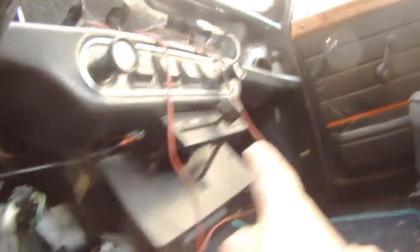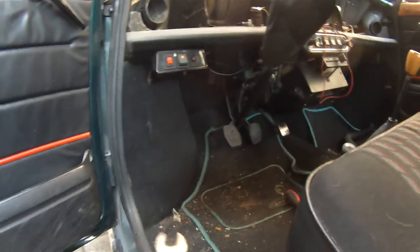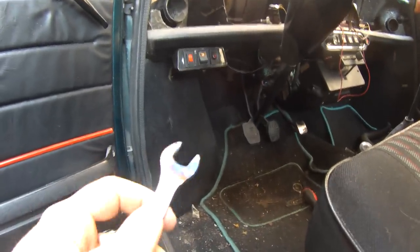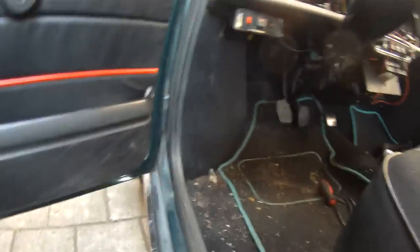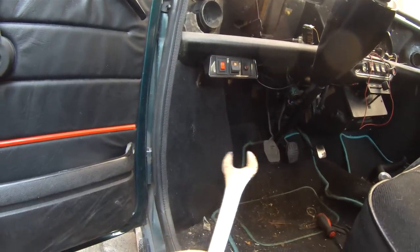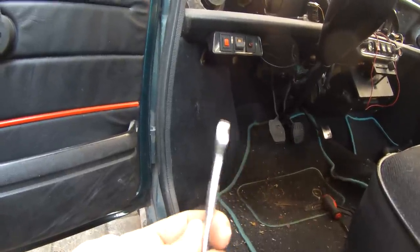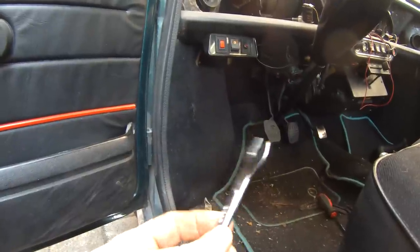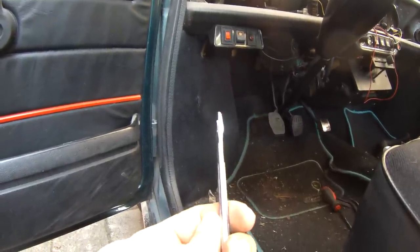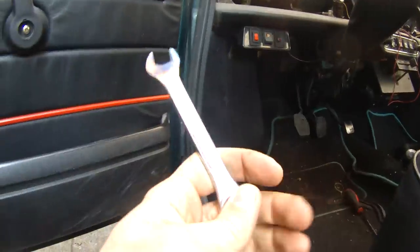Additionally, from what I've seen it can be a nightmare to undo since I have a power booster as well, because the shaft goes all the way across the bottom of the car. Looking at the assembly, the bolt is actually in between the brake pedal and the clutch pedal — a very, very tight space. So what I did was take a half-inch wrench, which is the right size for the nut, and I ground it down so it's nice and thin to fit in between that space between the brake pedal and the clutch pedal.